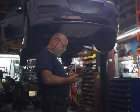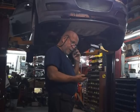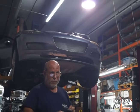As a protective measure on all vehicles, when you use E85, like flexible fuel vehicles, they advise you to use some kind of fuel additive, because the E85 is corrosive. That's why all flex fuel cars' fuel systems are basically stainless steel. Rubber is fine. The best rubber fuel line to use is the Teflon type, that has the internal stuff. Aluminum parts, E85 will eat that like there's no tomorrow. So hose was definitely a good idea to go front to back for fuel here, especially with E85, because if we'd used that aluminum tube, we'd have been in trouble with E85.